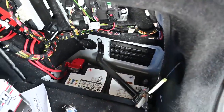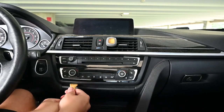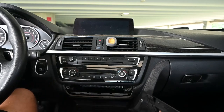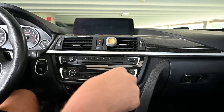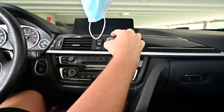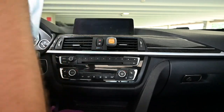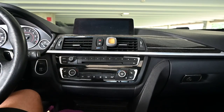The battery is unplugged. We're going to use this prying tool and go ahead and open up this bottom piece here. That's pretty simple. It doesn't look like we have any LED here — there would usually be an LED-type plug, but we don't have anything like that. The first thing we have to do is take out this trim. There are a few clipping spots and we just go ahead and pry it with this pry tool.